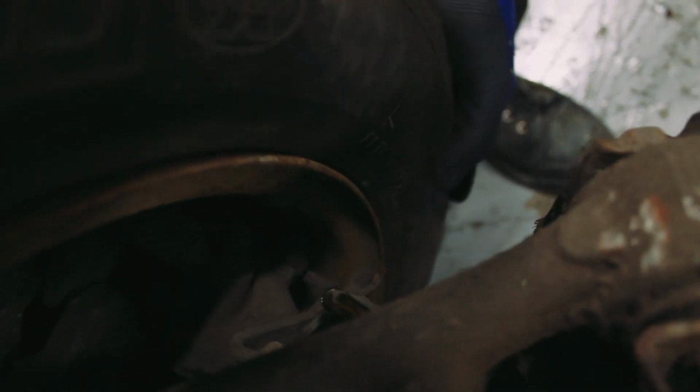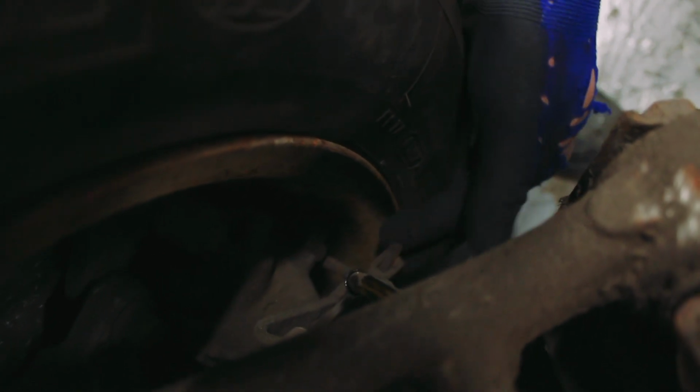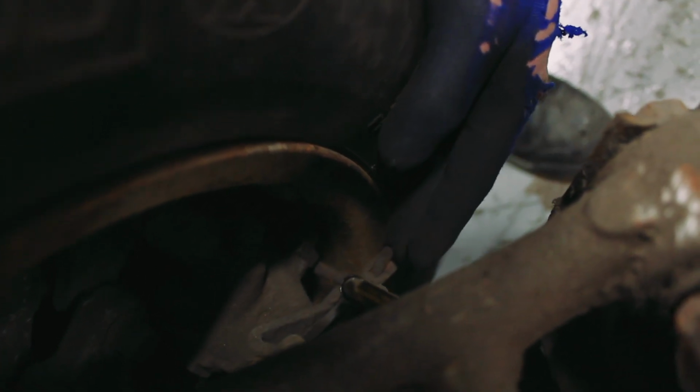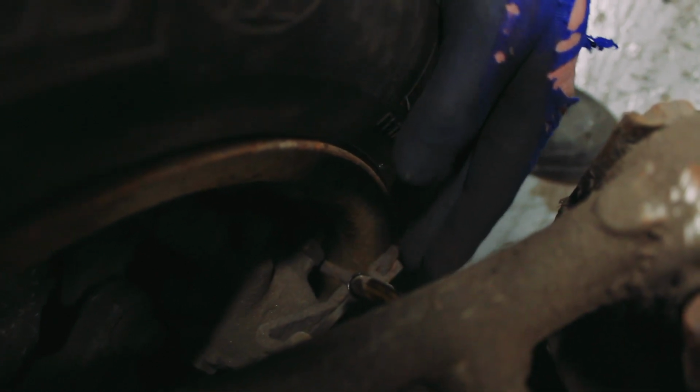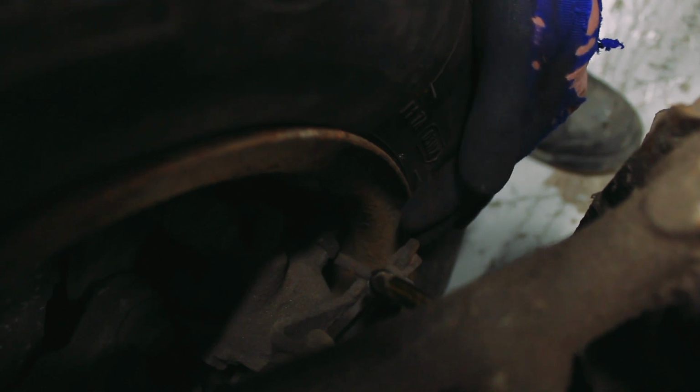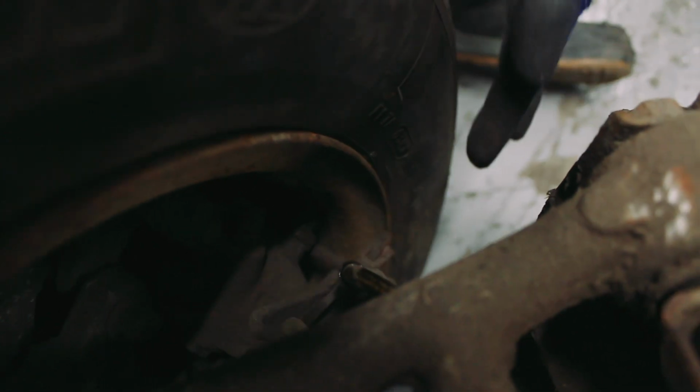So there's some things we've got to figure out, one of which is where the handbrake mounts onto the caliper. So I've got the wheel mounted onto the hub now, and you can see the handbrake lever that sticks out here. Again, it really is designed to sit inside a 16-inch wheel. Because we've reduced the diameter down to 15-inch, as I make the wheel wider, it is going to hit that. So it's not ideal. I don't really want to modify the handbrake if I can help it, but it's an easier thing to modify. And I know I'm not even going to get an inch of width before I make contact with that. So I think if I can go an inch outboard and then an inch inboard, that gives me an 8J wheel.